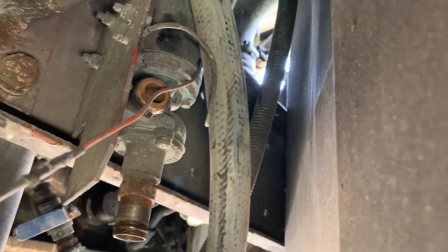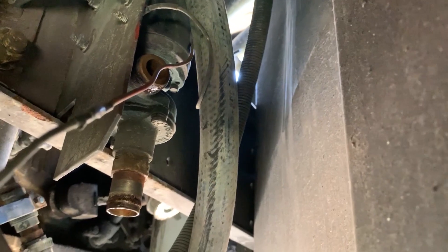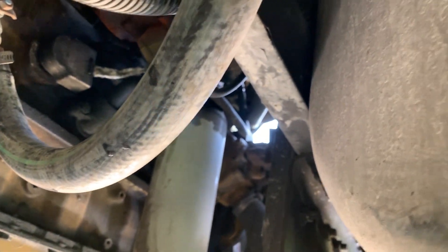You can see right there is the water pump, and you had them routed that way. But if you're taking it out, you don't have to worry about any of that. We unhooked the hose clamps, pulled the hoses out, cut all that stuff and pulled it out. Where it came out of the top, we looped it down, around the frame rail, and came right up into the bottom, right there. And that is the route.